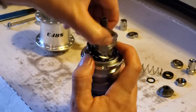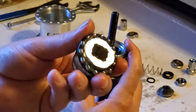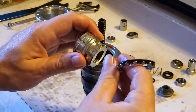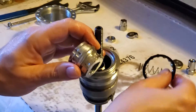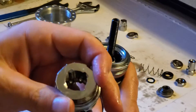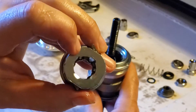Pull off the driver, which will take the bearing race off with it. That's the first real difference you see — this driver has pawls on it. This bearing ring is a plastic cage that's just retained. There's a set of pawls that are pushed down with a plate called an actuator plate, and in the middle of it is where the clutch engages.